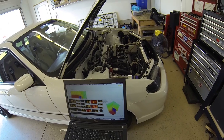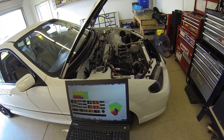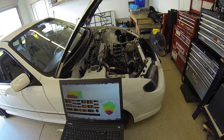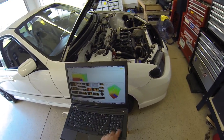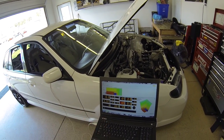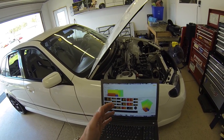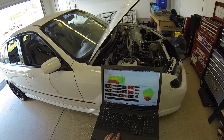...75 percent duty cycle — so the pump is four times more effective than stock. I very rarely see a duty cycle over 50 percent. Normally the car runs at 10 percent. That's all automatic: as soon as you start the car, the pump kicks in at five percent; as temperature goes up it hits eight, ten, twelve percent, and then ramps up quite high to maintain temperature.